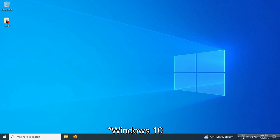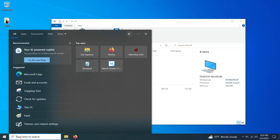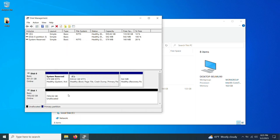Over here in Windows nothing really happens at first. If you look at USB devices you'll see the dock itself but no disk drive. Same thing in the file manager under This PC — nothing, just the C drive. What we're going to want to do is come down to the start menu or search box, or hit Windows+S, and type 'disk management.' It's going to immediately come up and tell us it's detected another disk and ask what we want to do with it. GPT is what you want. Now it's created an unallocated basic disk, so right-click and select New Simple Volume.